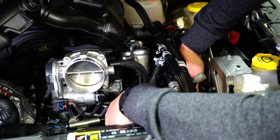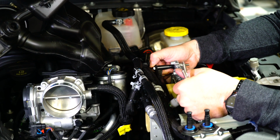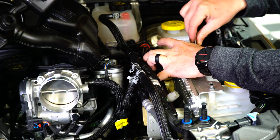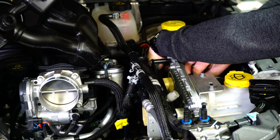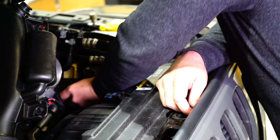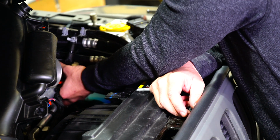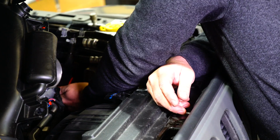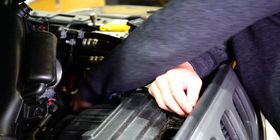Once you've got the Pulsar through the wiring harnesses, you're going to take the 3 provided bolts and align those with the holes that are pre-drilled into the Pulsar mount, and get the lock washer and thread those together. So now what we're going to do is take our harnesses and plug them into the Pulsar unit, and press down until it locks into place.